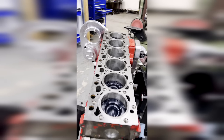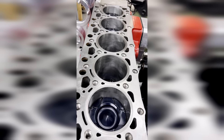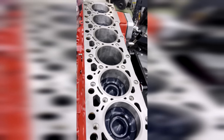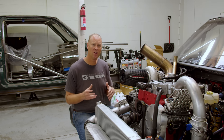Keeping this thing water-cooled is of the utmost importance to me. I took a stock 6.7 Cummins block and sleeved it down with some Power Bore sleeves down to a 4-1/8 bore. That puts me at a 6.4 liter Cummins engine. Then I topped it off with some Diamond forged pistons and some Wagler rods - it's a pretty decent build. It should handle some good power; 2000 horsepower should not stress it too much, and that should be enough to be competitive in my class.